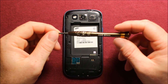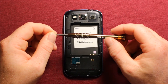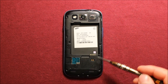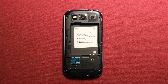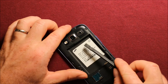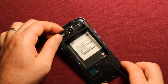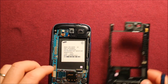Next, what you will want to do is have a Phillips screwdriver that's size 0000, and you will want to remove the screws — there are about ten of them — all the screws that you can see. Then you will want to take something like a pry tool, and I found right here is a good spot to pry right under here, where you can separate this back part, and then you can just kind of work your way around and this back cover comes right off.